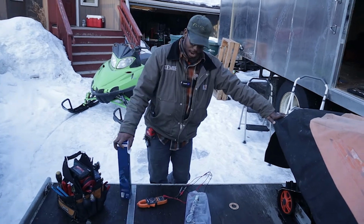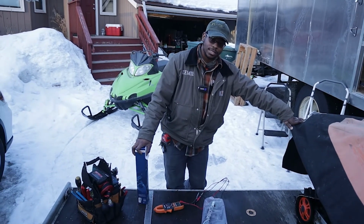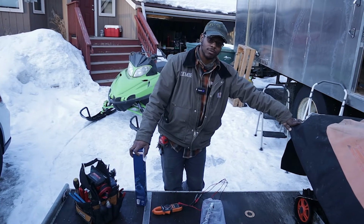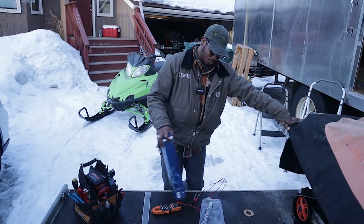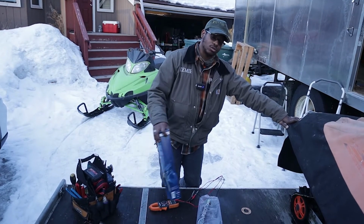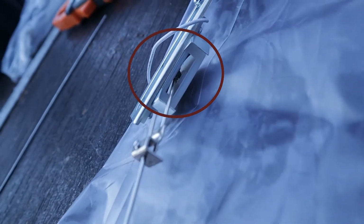That got in today. After I pulled the old unit out, I tested it again, and this time I scratched the surface with my leads and I got the right resistance. So my sender wasn't broken, that was completely user error. But I did break it when I was trying to weld up the tank, so I'm gonna replace it with a new one anyway. I broke it and then I fixed it, and it would have worked if I didn't fail. Now here we are.